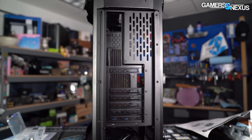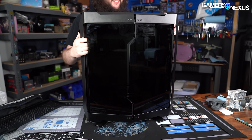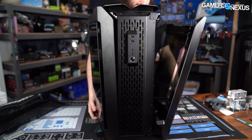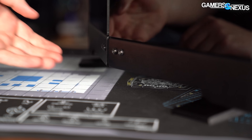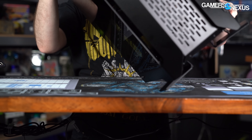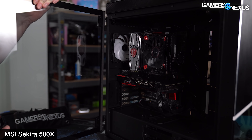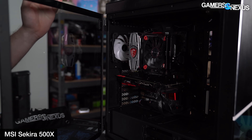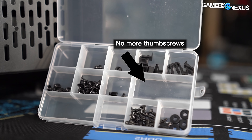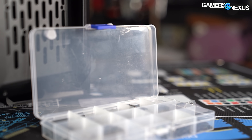The case is approximately 35.5 centimeters across at its widest point, well beyond the 28.5-centimeter width of the O11 Dynamic XL. The minimum desk space required for the performance layout is a wide 32-centimeter stance due to feet spacing — and that's with overhang at the desk. Moving the case firmly requires securing the panels with thumbscrews, up to eight total, and blindly installing four of those thumbscrews at the bottom of the case is almost impossible. The Odyssey X ships with what seems like a massive surplus of thumbscrews, but every single one ends up used in the performance configuration — there are no spares. There are at least extra plastic snaps, which we appreciate since they're the most likely point of failure.